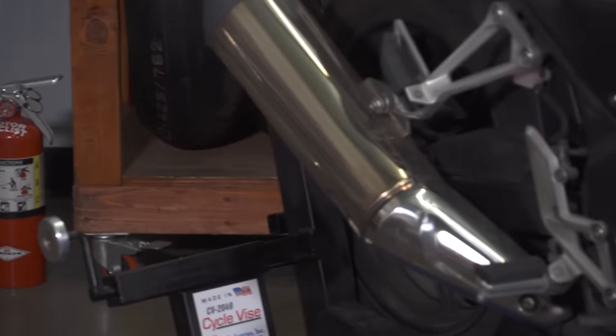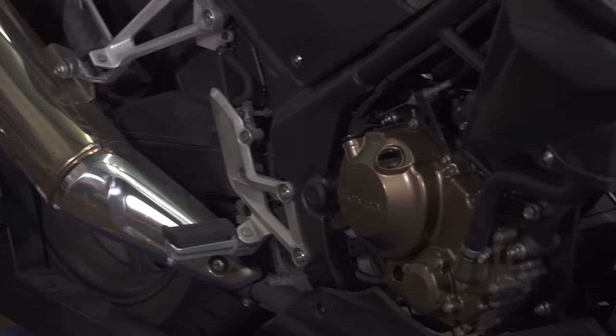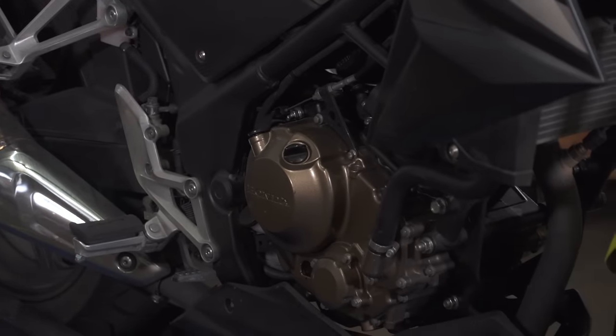So we've more or less shown that it doesn't matter how you break in an engine — the results are going to be the same. Not so fast, though. This CB300F, even when being run at full throttle, just isn't working that hard because it's in a mild state of tune. If you're on a more high-performance bike, like a CBR 600RR that revs to 15,000 RPM, I would not recommend going right to wide-open throttle. Each engine is going to be different with different cylinder materials, different compression ratios, and different redlines.